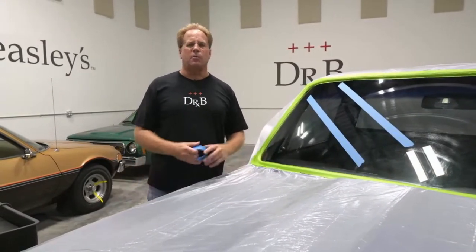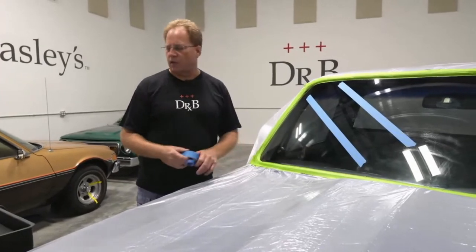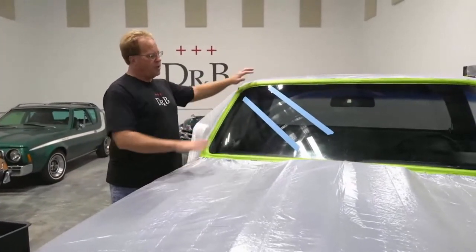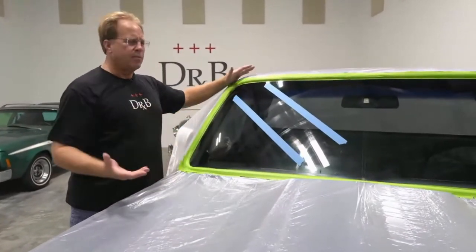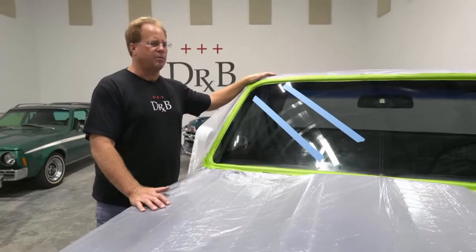And the problem was they didn't have patience or persistence. It's not gonna buff out like that. You gotta spend some time with it. For me, and I'm pretty good at this, it would take me about 2 hours, after all the prep work, of solid polishing to do this half and the other half. Maybe 3, because this has some pretty bad wiper marks. But that's not taking any breaks at all. That's just polishing, never stopping.